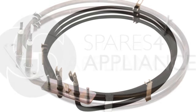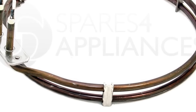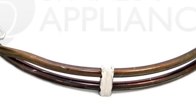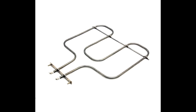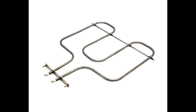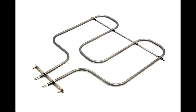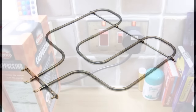If you've replaced a couple of these elements, what I would recommend when buying one is to make sure that it has these two supportive joining brackets between the two elements — I'll show the reason why a little bit later. Finally, it's worth noting you can buy pretty much all of the elements and thermostats for your oven online, so there's no real need to call out an engineer just because one has blown.